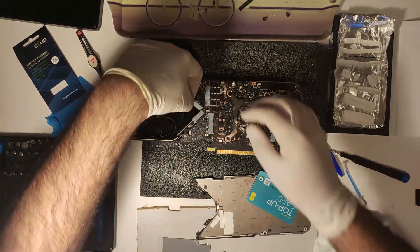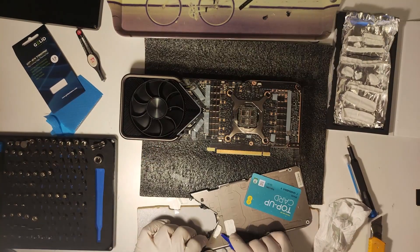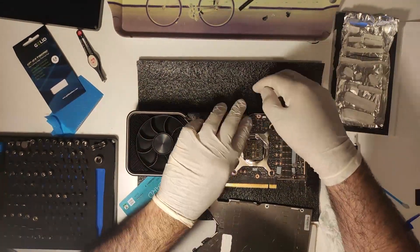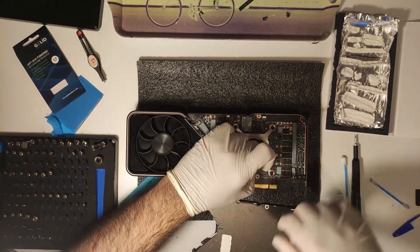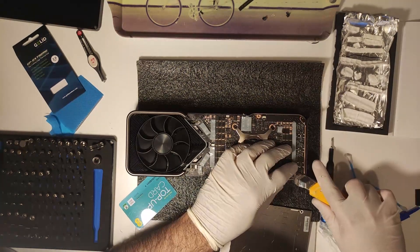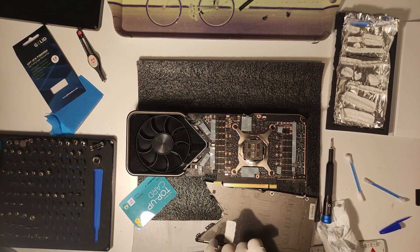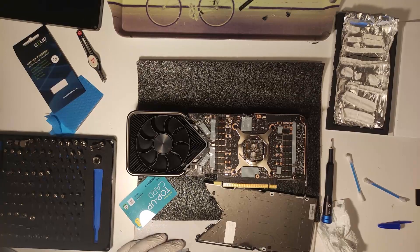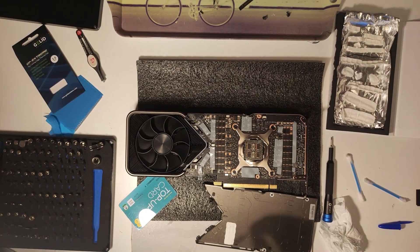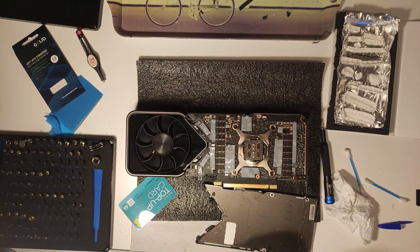If everything is to your satisfaction, clean the back of the card just as well as the front. Remove the pads, clean everywhere, and put fresh thermal pads on the back of the PCB. This is much easier than the front as you can see what they're doing and they won't fall when you flip it over. There is one large and very thin thermal pad measuring about 0.4mm — I ended up reusing that one, as the back thermal pads do not make that much difference and I couldn't justify buying a 0.5mm pad just for that. I deviated slightly from the schematic in the description: I only applied thermal pads on the back of the memory chips themselves and on top of the important components as outlined by the OEM pads. Your GPU is already overperforming its stock thermal condition by a wide margin — this is just the cherry on top.